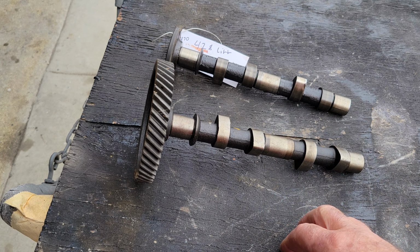But if you don't want a rougher idle, you want a smoother idle, then you can go with less lift and achieve that. Anybody price conscious? I think a few of you guys are, like me. Let's look at price conscious cams. Scat C20. We'll look at it on air-cooled net. It's about 85 bucks. If you're looking for a cheap cam that wants to work good, Scat C20. I like the C25 better, personally.